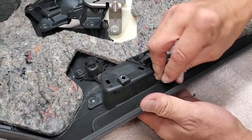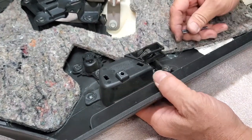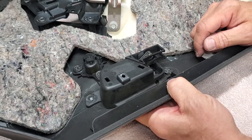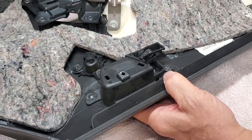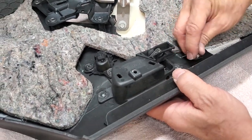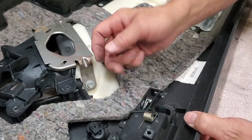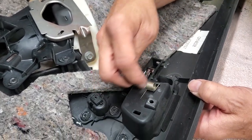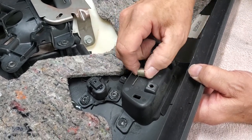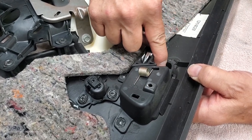Now, you see you can't put the pin in there. And you can't go the other way. So how do you put the pin in? This is going to be the Armstrong method of how you get the pin in. So I'm going to show you how you do that. Another thing you're going to want to have available is your spring. This is the spring you're going to use. It's your brand new spring from this set. Notice you have two legs here. This leg and this position, notice how I've got the spring, this position, this leg goes in the slot. There's a slot right there where my fingernail is.